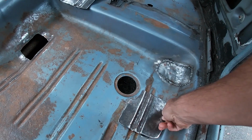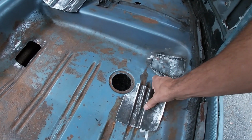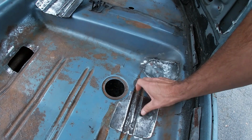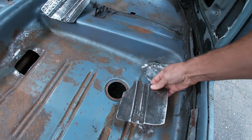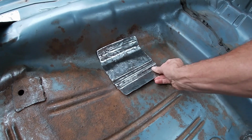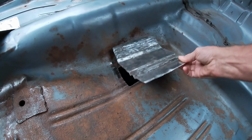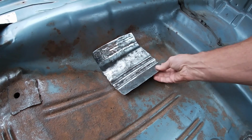And then drill the hole again for the screw, because I'll get new seat belts and they come with bolts and washers. So there's this plate behind the floor, so if something happens, like a collision or accident of some kind, you're not pulling this plate off of the floor, it's behind it. And I did the same with this one. So there's the two grooves here, and that'll just spot weld to the floor from the back. It's pretty close to the curve, so I left some meat here. So I'll drill holes in the floor, weld this from the bottom.